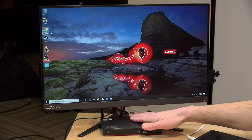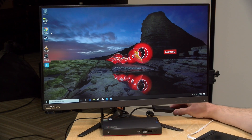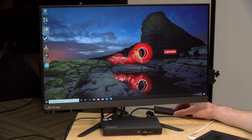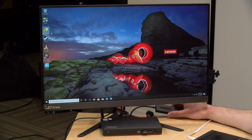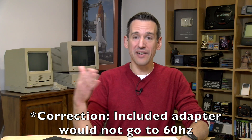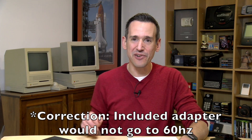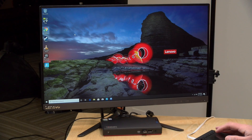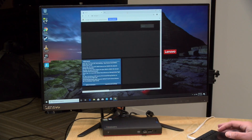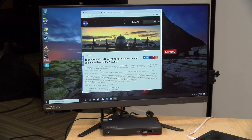With the computer booted up, note that there's no HDMI port on the back, but they do include an adapter in the box to get HDMI out of the rear USB-C port. The front USB-C only does data — only the rear one delivers video. You can use the DisplayPort, the rear USB-C, or both for a dual display setup. I was very impressed with how snappy this thing is — it's a full-performance machine in a mini PC shell, so web browsing, word processing, and everyday tasks are very quick.